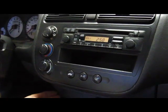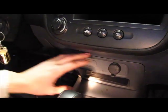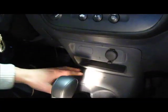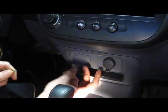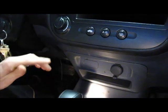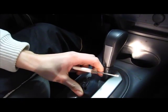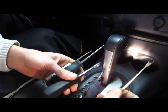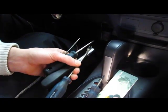The first thing we need to take off is this middle part of the console. On the 2004 model it's fairly easy to take off. The main point is to take this cover off and get to the two screws holding this radio console in. The tools we need for this particular model are a small Phillips screwdriver, a longer Phillips screwdriver, an 8mm socket, a clip removal tool, and an old credit card — you'll see why later in the video.